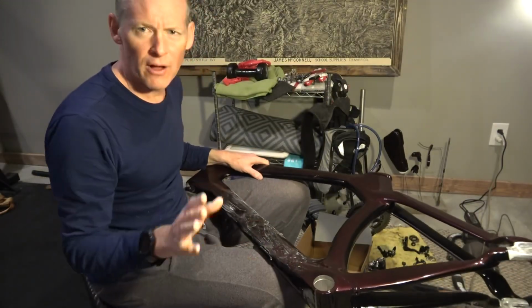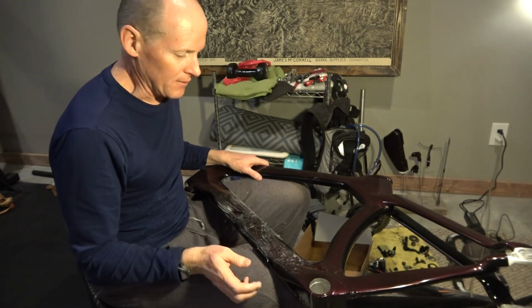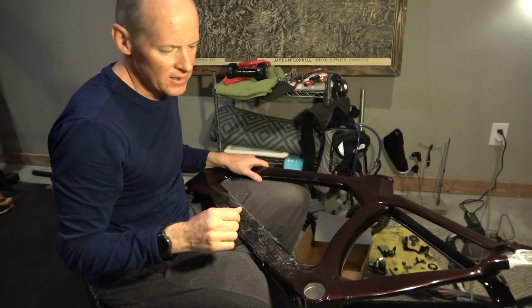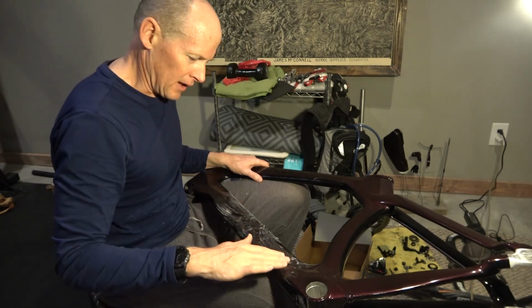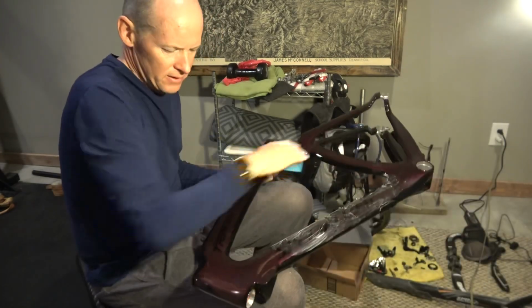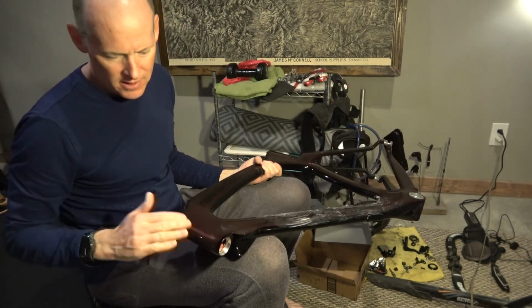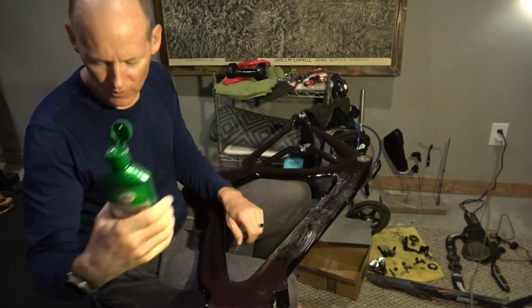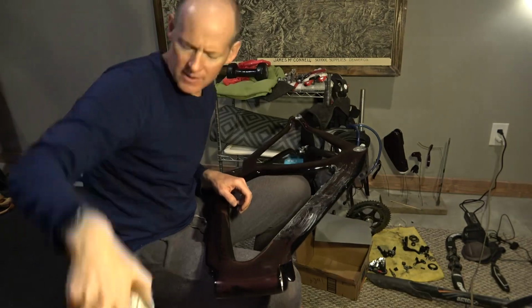So if I end up putting a second coat on. Alright, so getting rid of all the orange peel that is on the clear coat. Clearly, I'm not professional at this, so I don't know. Some areas of the clear coat were nice and smooth. Some areas I actually had some runs on, so I had to fix those. But you can feel, you can hear it even, the orange peel on there. And I want to get rid of that. So I've been trying various methods. Turtle Wax scratch and swirl remover. I tried some Turtle Wax polishing compound, and none of it really takes it off.